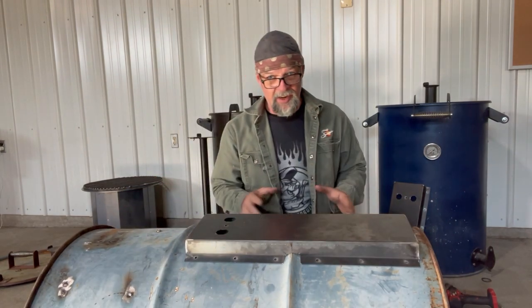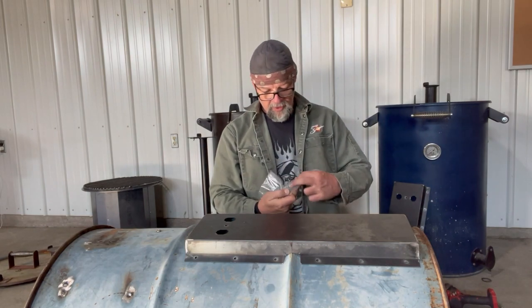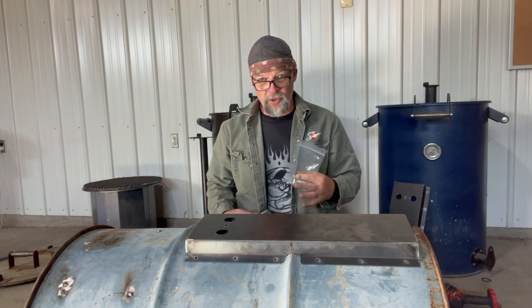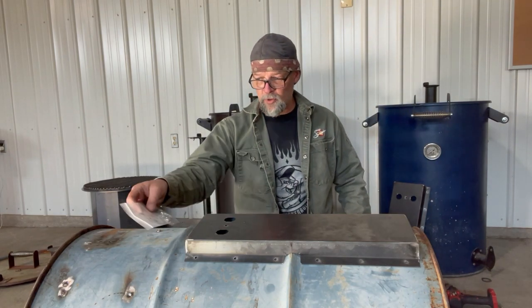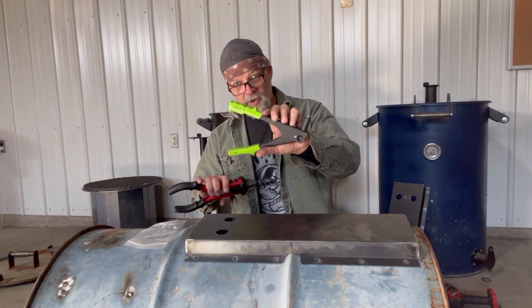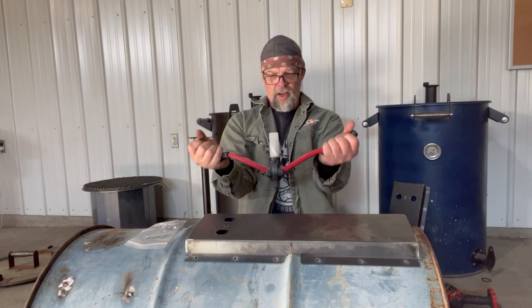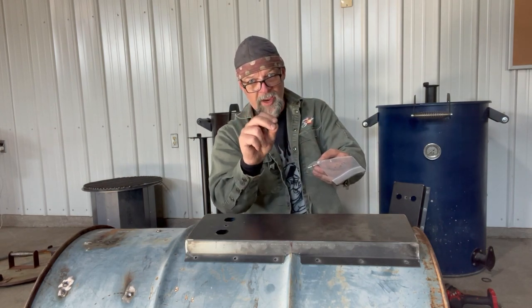Okay, now this part's pretty simple — you've pretty much done something like this before. First thing you've got to do is decide on hardware. In the kit you're going to get two different kinds: some three sixteenths rivets — that's part number two, there's 24 of them — and some five sixteenths zip screws with a drill point on them. My favorite is the drill points just because they're so fast. The rivets are pretty good too. You're going to have to supply your own rivet gun of course. Both of these came from Harbor Freight — they're both meh rivet guns. This one here is a love-hate relationship. This other one costs another five dollars and it's a lot more accurate; it's a better rivet gun altogether. Both are very effective.